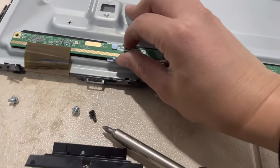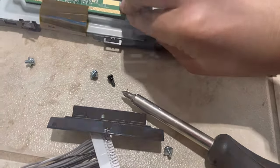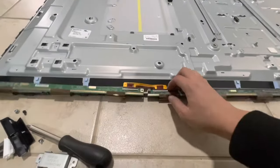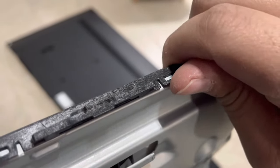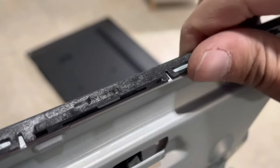For the buffer boards, push down with your thumb on the lower clip and then pull the board upward — it will snap out. Do this across the row and now the buffer boards are free. Beware: there may be one more row of black clips holding down the LCD panel, and once these are removed, the LCD panel will fall right out.